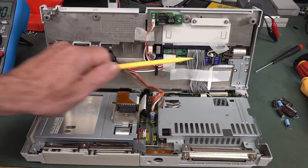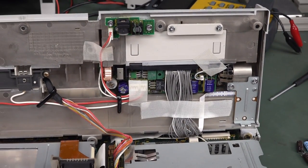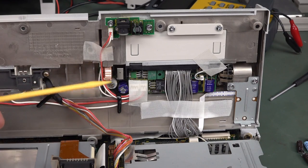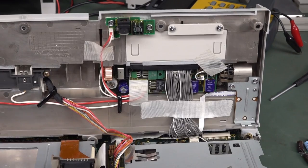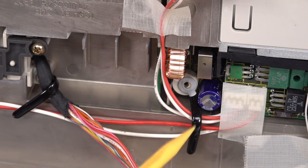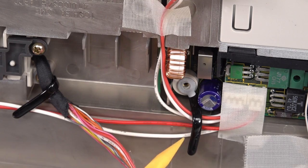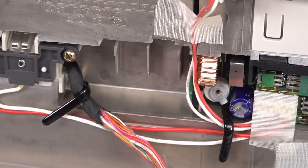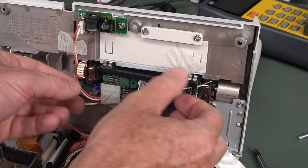We've got another switching board here, so we'll have to recap those as well - they're probably gone. I do like the attention to detail: there's a bent metal tab just held in with a screw after assembly to keep cables in place - they've got another one over here as well. Very nice touch. Wow - another complete switching regulator in here, and that is chock-a-block. It does the battery as well, and this goes over to the backlight for the screen.